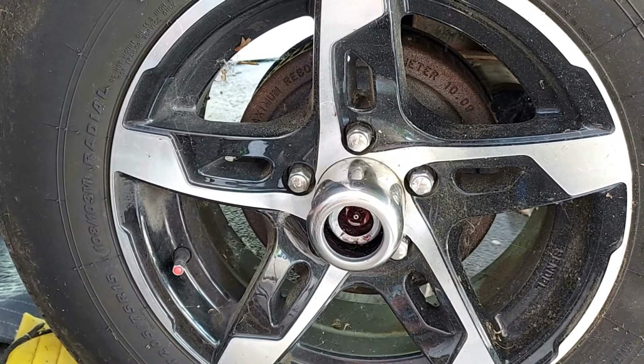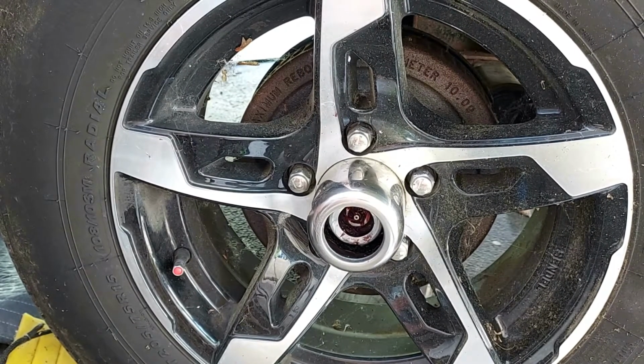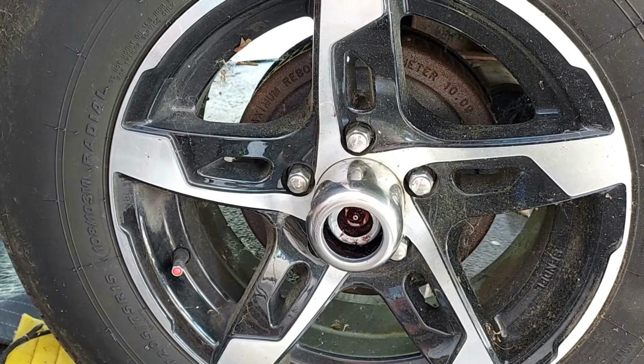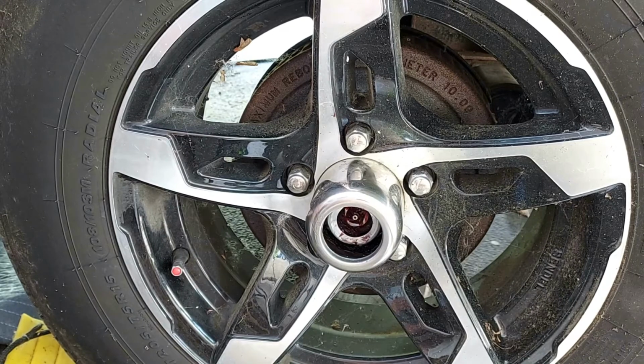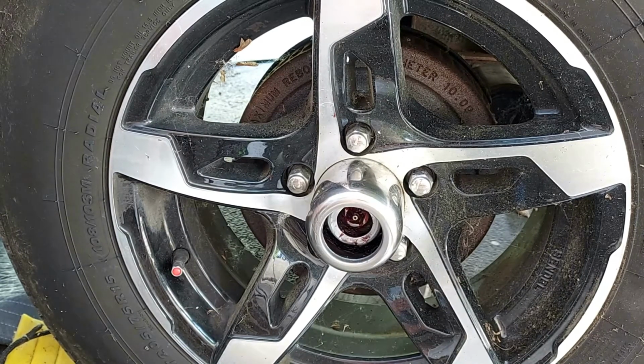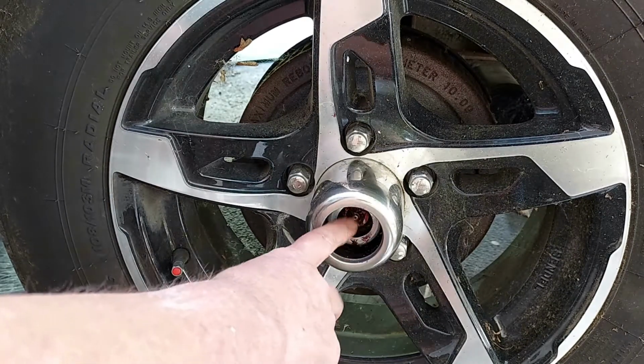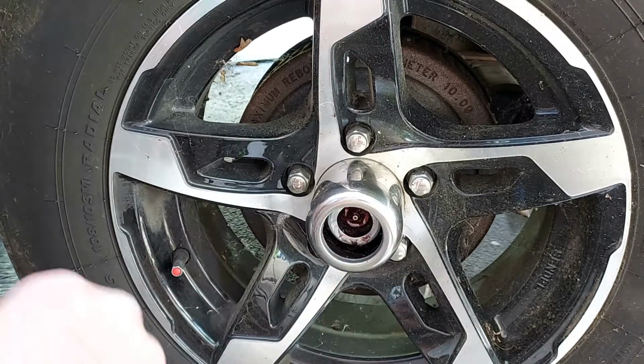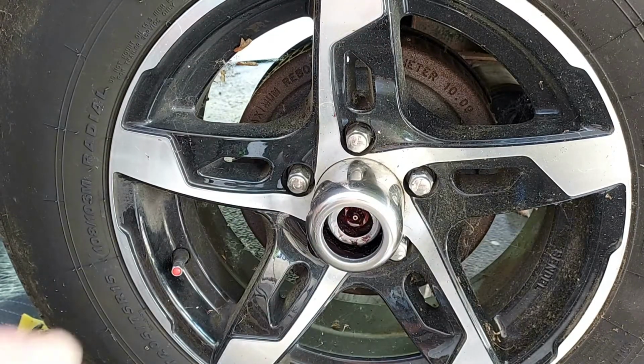Okay, we're going to end up doing this bearing now. One thing I want to point out in the description is a link to Dexter for their E-Z Lube procedure for greasing it. We're going to proceed here, show you on the video. Take a look at that. The thing I want to point out is this right in here, this edge. It's very sharp. So don't use your direct finger on it. Make sure you have a paper towel or something protective when you're cleaning out the grease.